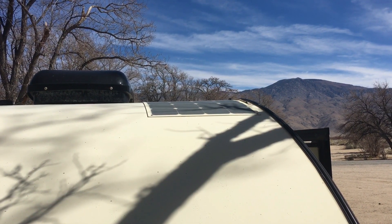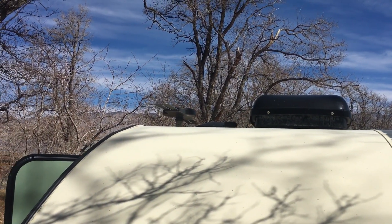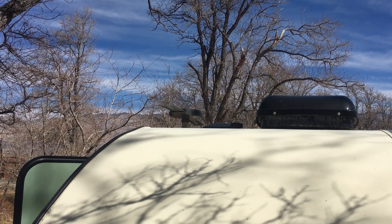It made more sense because it's a shorter wire run to the TV. Jim figured out where to remount the TV antenna and accessed it through the speaker hole. He drilled and secured the TV antenna just forward of the hatch, drilled a new hole for the coax cable, and ran new cable to the TV amplifier. That's the front of where the panels are on the roof, and over here is the remounted TV antenna — excuse the dirt, we've been camping for a week.